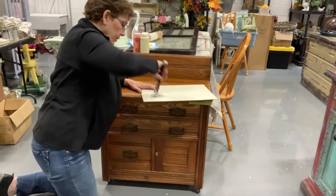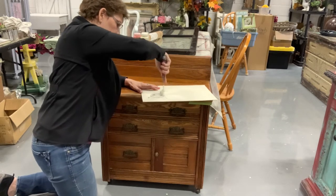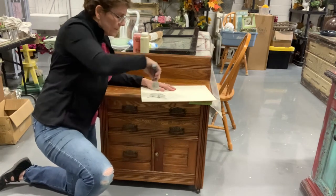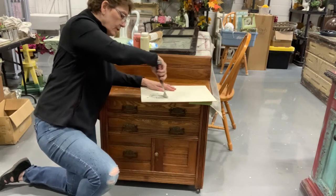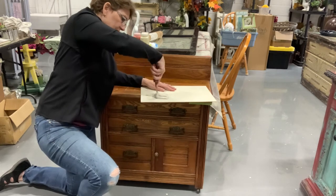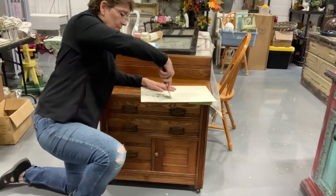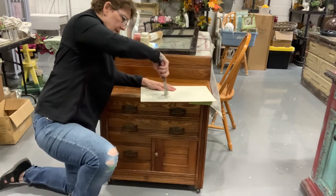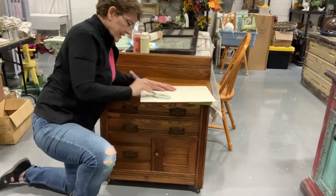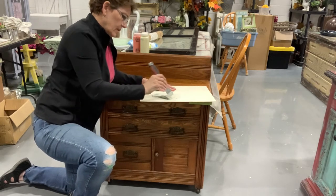You only have about four or five minutes to use it before it starts to really set up. So we're mixing all of this together on a board — they suggest a non-porous surface, obviously, because if it's porous you're just going to be pushing it down into it and getting it all absorbed. I don't know how to tell when it's all mixed. I think I like products that change color when they're mixed properly — maybe there's a Bondo for beginners that does that. I think you can tell because it starts to get thicker, so it's not quite as gloppy and would stay put.